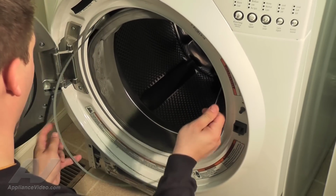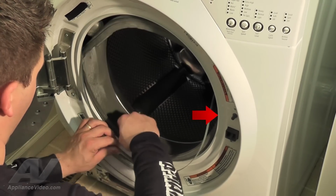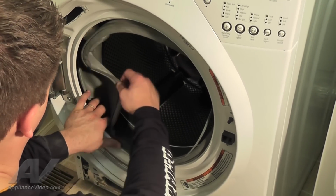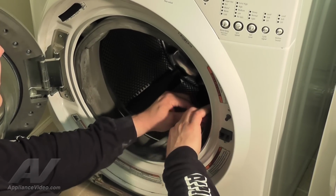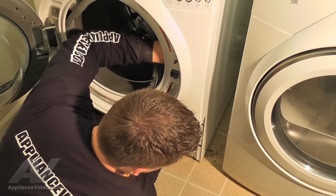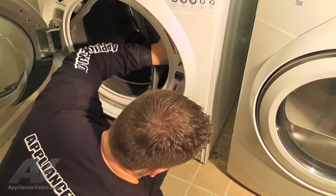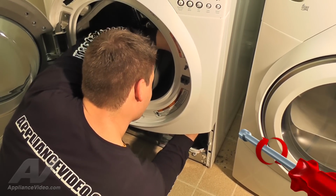making sure the 5/16 screw is facing downward on the right side of the washer. Push back the clamp around the lip of the bellow on the inside of the outer tub. Using an extension bar with a 5/16" bit and ratchet, access the clamp from the bottom right side of the washer and turn the screw clockwise until the clamp is snug.